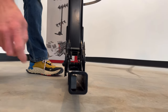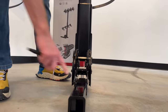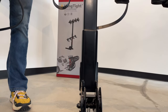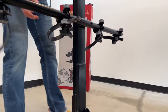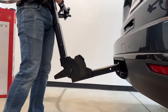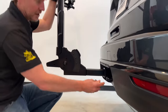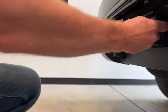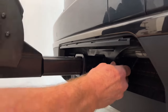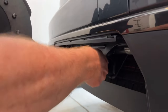Construction-wise, yes, heavy-gauge steel throughout — very heavy-duty construction overall with very robust welding, designed for extra heavy-duty use. Let's go ahead and lift this back up into place. I'll insert it into the receiver to get it started, then I'll be inserting the hitch bolt as a feeler so that as I push forward it'll find the hole where it needs to thread into, and then I can begin threading that on.